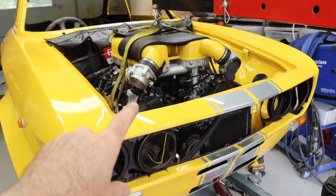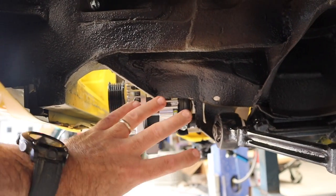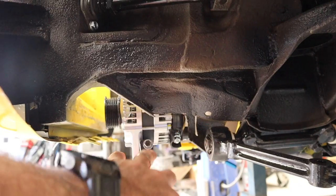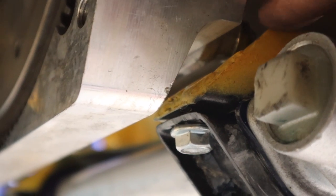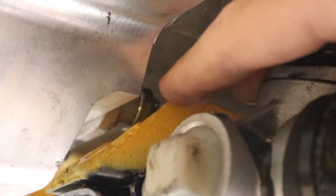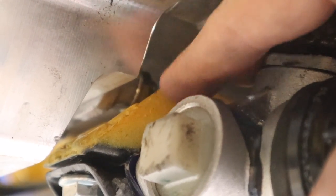We have an engine kind of in the engine bay. I've managed to get the engine mount in on the passenger side, but I did need to cut out a little section to fit the new Wasp alternator, because when I did the original mounting I did it with a Camry one and this is a slightly different mounting - it just interferes. I'll do some more reinforcing later, it's easy enough to do in the car. On the other side I have an issue - a bolt for the engine is touching my mount for the steering rack. I thought I'd clearanced everything, but I'm going to lift the engine up, do a little extra clearancing, and put a much smaller nut and bolt on that corner to get as much clearance as possible and allow a little engine movement.